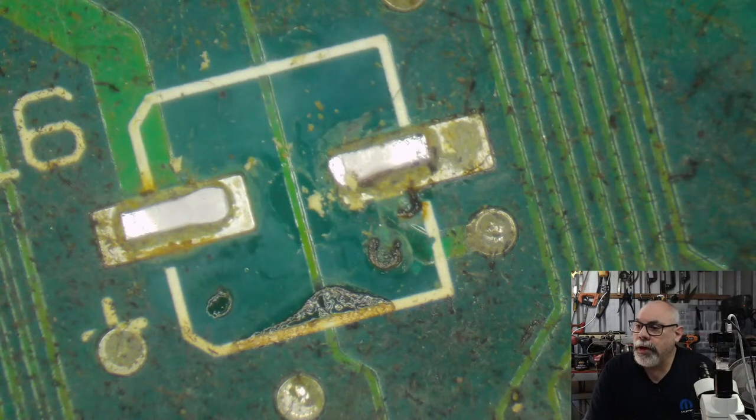Do certain Macs have better solder mask that protects the trace from capacitor gunge? Yes, definitely. There are some where the mask is very, very thin and comes off really easy, and some where it's quite a bit thicker. In the summer there, you probably won't need to use the hot air station to remove the caps. Yeah, it gets a bit warm here, and apparently it's going to keep getting warmer, so that's something to look forward to.